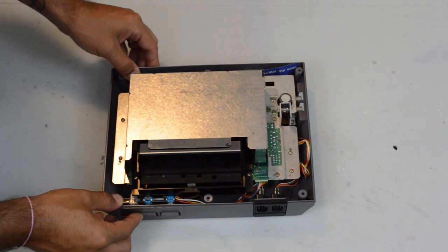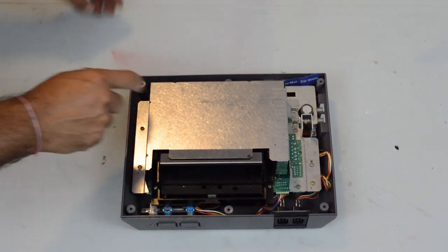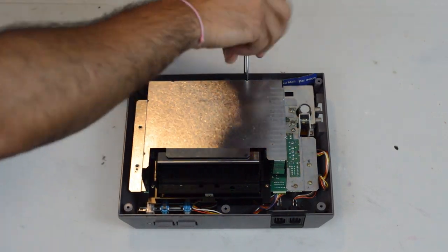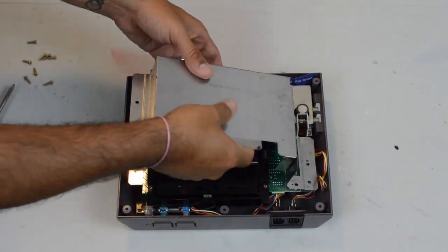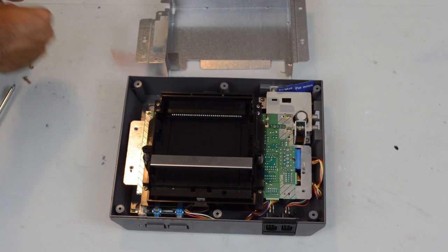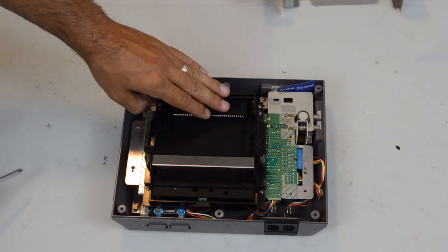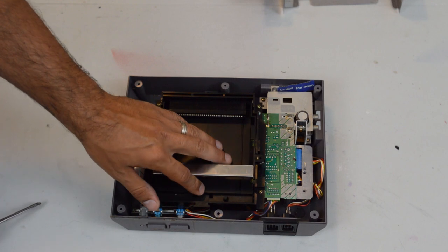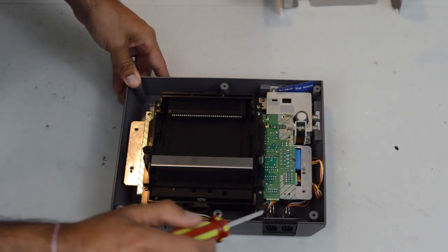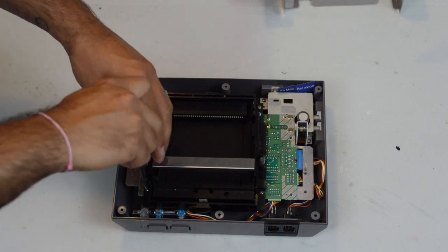On the inside we're going to first have eight screws to remove to get the metal plate off, so we're going to want to remove that. Now that the metal plate is off, we'll set it aside. I'm putting the eight screws that go with the metal plate on the inside separate from the ones from the case. This is basically the toaster part of the NES that lowers the cart into the 72-pin connector. We're going to have six more screws to remove — one, two, three, four, five, six — and again set them aside, keeping them separate by size.